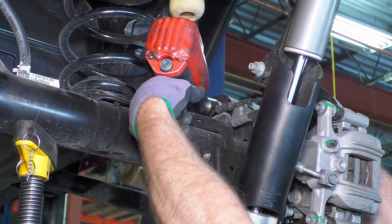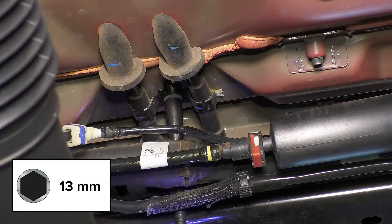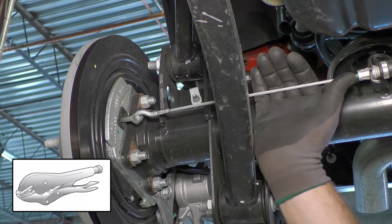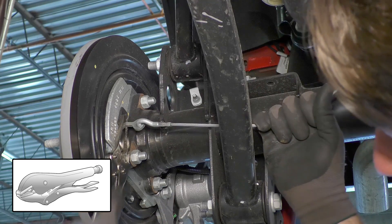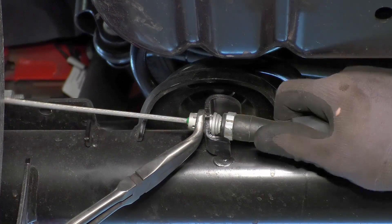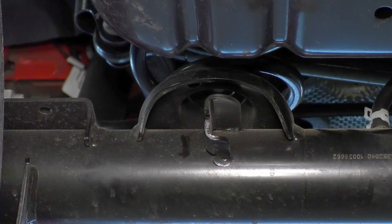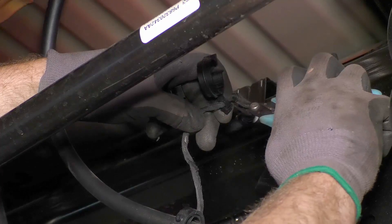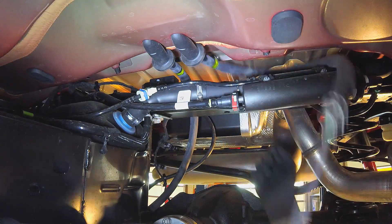Moving to the rear, loosen but do not remove the control arm bolts. Remove the emergency brake cable bracket located on the vehicle body directly above the rear-most driveline joint — this bracket will not be reinstalled. Pull down on the emergency brake cable and clamp a pair of locking pliers onto the e-brake eyelet. Disconnect the e-brake line from the eyelet and leave the locking pliers in place until the e-brake line is reattached. Disconnect the e-brake line from the axle — the connector has three tabs that don't press in easily, so use pliers here. Detach the e-brake lines on both sides before proceeding. On vehicles with pre-installed lockers, the locker actuator wiring is connected to the e-brake lines; detach the brackets and remove them from the wiring — you will not reattach these. Feed the cables up over the cross-member and fuel lines so they will now travel underneath the cross-member and fuel lines.